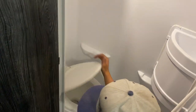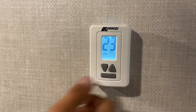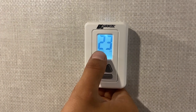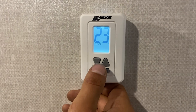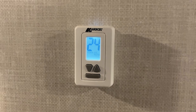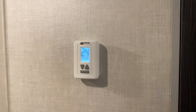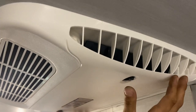The thermostat — press the bottom bar to wake it up. It starts from off, then fan speed, which just moves air with no cooling. You've got low and high fan. After fan speed it comes into cool high, where the high fan runs all the time and cooling cycles in and out as needed. Cool low uses the low fan all the time with cooling cycling in and out. In auto, the fan and cooling both cycle in and out on demand. With the air conditioner going you've got two louvers you can close off to choose where you're directing your air.